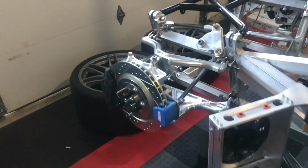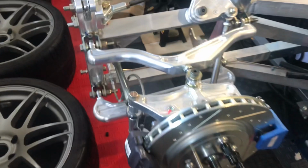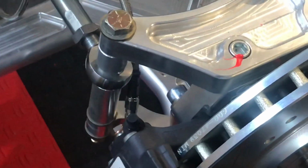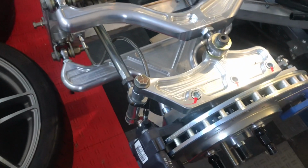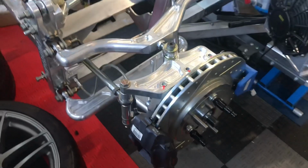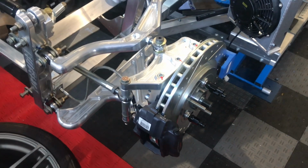All right, moving on to the rear brakes. So in an earlier segment, I mentioned that I was going to order a 90-degree fitting for the back line here. And it turned out the fitting sort of interferes with this toe rod attachment, so there was no way to use it. So I'm going to go with the recommended setup.